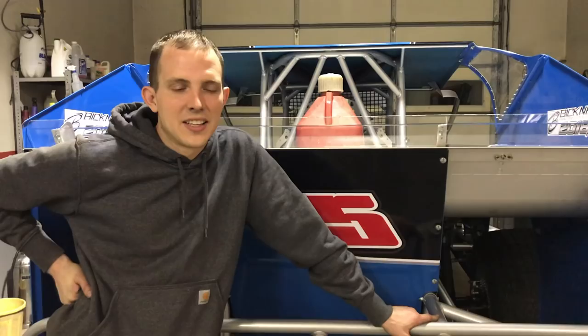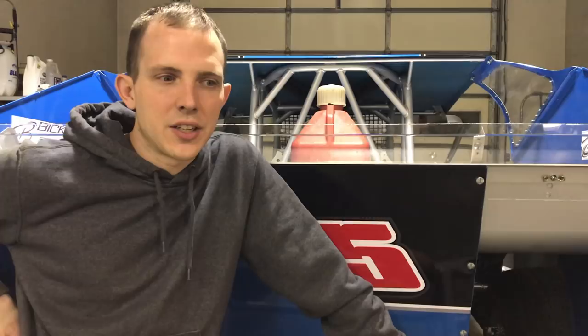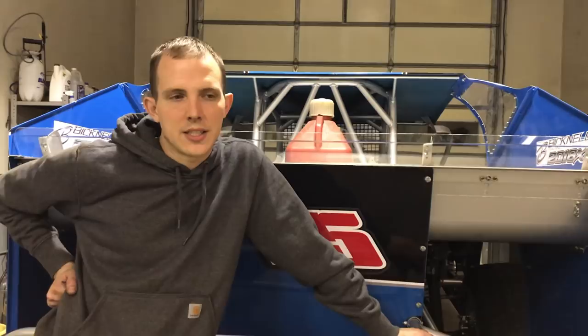So the reason you scale cars is for consistency. If you don't scale you never know. We're on a torsion rear suspension here. Your torsion bars can go south — they twist, so when you put turns in it, it twists the bar and sometimes you lose turns. So you're looking for consistency in your numbers.